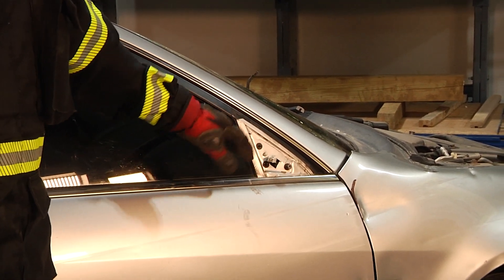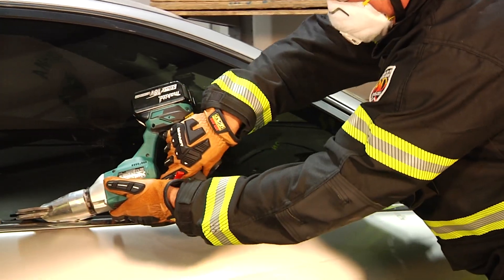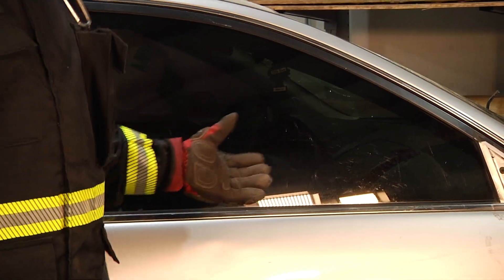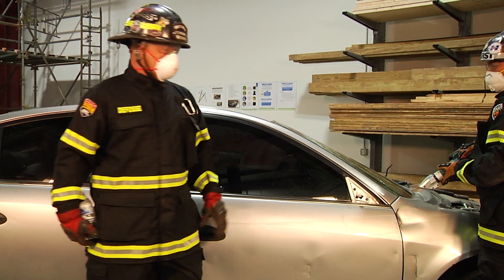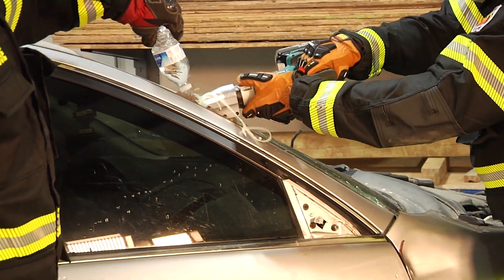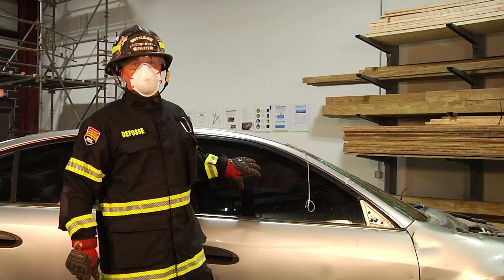This example is actually tempered glass — we'll show you on laminated glass in a second. As you've seen, Kirby came in, made his purchase and cut along the bottom. This separates the glass from the door frame, and then we can reach in, grab and pull and remove that whole sheet of glass in one movement. Next, Kirby's going to demonstrate a puncture and a little glass management. By using a little bit of water to pacify the dust, we control dust because we've yet to make contact with our patient at this time.